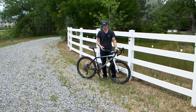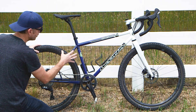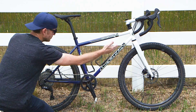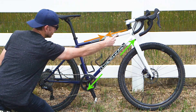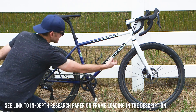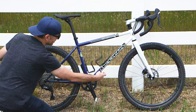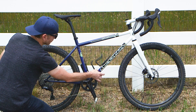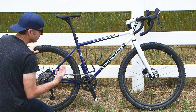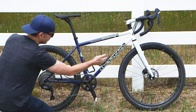I know many of you are going to have concerns that cutting the slots in this frame has weakened it. If you look at this frame, when your body weight is on it, the front wheel wants to go in that direction — that puts the down tube under tension and the top tube under compression. The force on the down tube is going to be in that direction. The sides of the tube, given how this is put together, have almost no stress in them. All of the load is carried by the top and the bottom of the tube, so putting the slots in the side in the area of least stress is not going to weaken the tubes in tension or in compression.